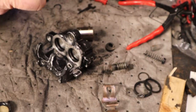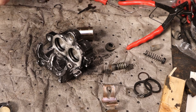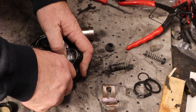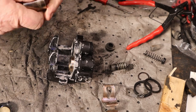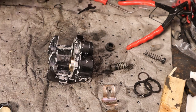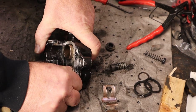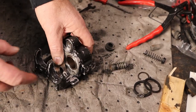Our pistons are in relatively good shape. I'm going to put just a little bit of brake fluid on here as well, put it around my thumb, set it in here, and just kind of love it in place and not let it tear those O-rings up. If something goes wrong, you can feel it going wrong — just got a feel for it. Don't go slamming stuff together without getting a good feel for what's happening. Put a little on that one too. There we go — it's a nice fit.